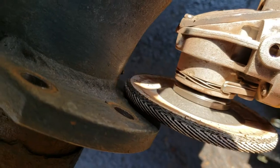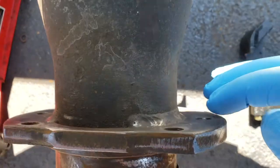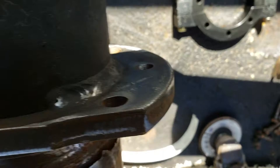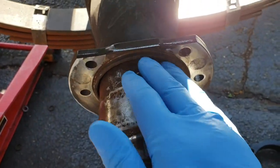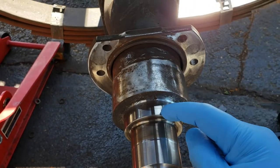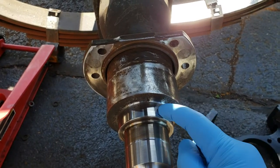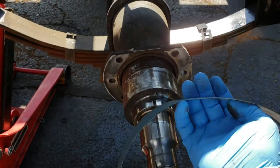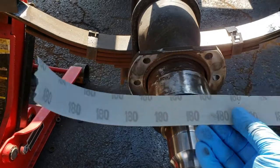To eliminate the welding bumps, I'll use a grinder with a 60-grit abrasive disc. Grind all the problem sections in the back to eliminate those bumps — including a bump on the axle itself. Check all the way around and do fine grinding to make sure the back is as smooth as the bracket surface. Also use the grinder to clean more rust from the spindle. For the seal section of the spindle, do not use the grinder — use 180-grit sandpaper manually for that area.